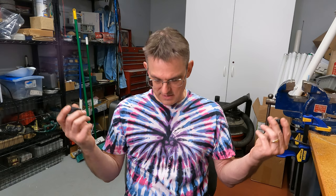Mission accomplished — that worked! For $20 and change you can do this yourself, instead of spending a couple hundred dollars or more on a new office or gaming chair — they can get crazy expensive. They all have essentially the same cylinder; the only difference is the stroke length. If you can find the size of yours, you can buy the kit to replace it yourself in a matter of minutes, which you just saw. You just breathe new life into an old office or gaming chair and save a ton of money. $20 beats spending a few hundred dollars, hands down. Thanks for tuning in to Half Moon Tech Labs.